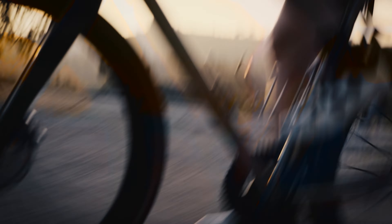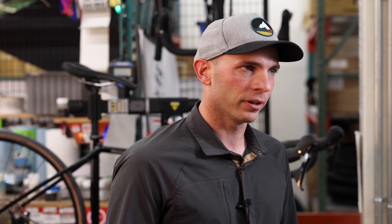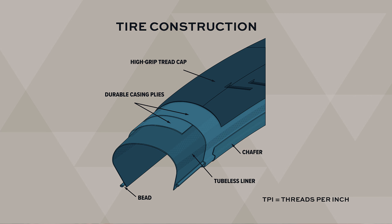And focus on maintaining grip in high-speed corners. All this occurs because the tire is built upon TerraVale's lightest casing to date. Our 120 TPI casing is more compliant than our traditional 60 TPI casing, but it still has reliable tubeless ready performance because of the use of a tubeless liner on the inside of the tire.